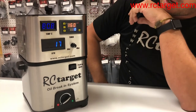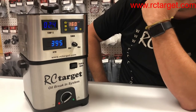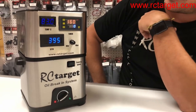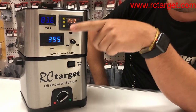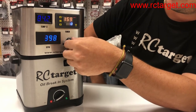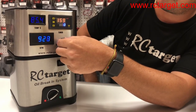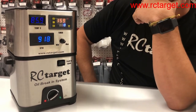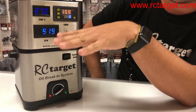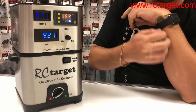I'm going to start it right now. We have it at 160 — I will reset it again. Right now it's showing almost 400 RPMs. The way we like to do it is 160 minutes at 900 RPMs and around 90 degrees Celsius for the oil temperature. I'm going to increase the RPMs now. That's about where we leave the RPMs. As the engine breaks in, you can see a fluctuation in the RPMs, but it will always stay around that. We're going to leave this engine breaking in and come back to show you when it's done.